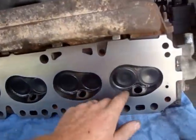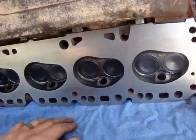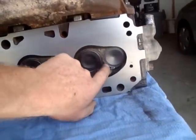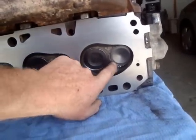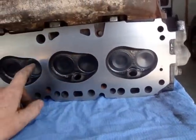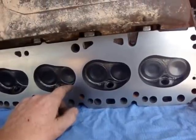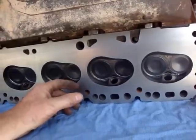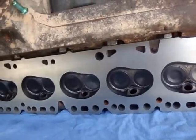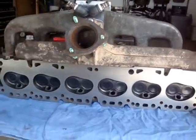You get better compression and a closed combustion chamber for a better burn. I had a guy rebuild this in town — he did a pretty good job, doing a three-angle valve seat with a two-angle valve job, just to get better airflow. I also ported the head before I took it to him, did a port match of the runners, and blended the bowls really well, tried to open it up as best I could. The idea is not to get mass airflow, but just efficient, smooth airflow — trying to build torque out of this engine, so hopefully I'll get more power at mid- and upper-range RPM.